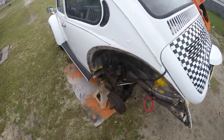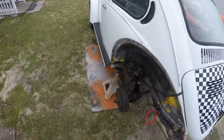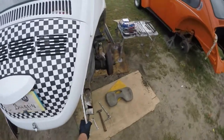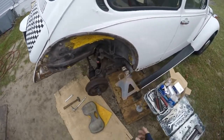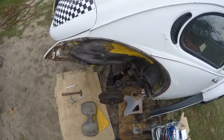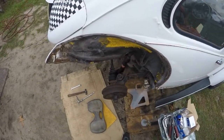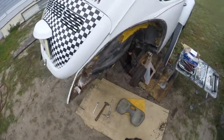I've already done the bearing replacement over here — wheel cylinder, axle bearings, wheel bearings, whatever you want to call them. Replaced all the brake pads and freed up both adjusters in there, they were seized. We're still waiting on the rear apron — I don't want to go any further than that until it's in here. I'm going to go over here and do the same thing: replace the wheel bearings, wheel cylinder, and brake shoes. These adjusters are frozen also. I still need to do the front brakes; I may not get to it today.